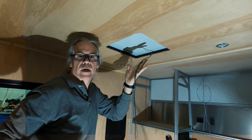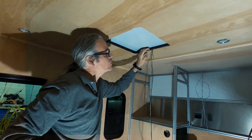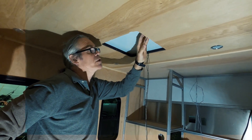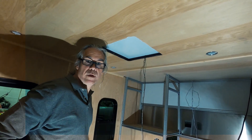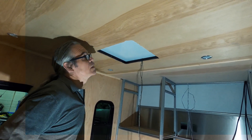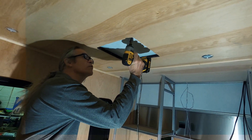At this point we're ready to install the fan — the Maxxfan — and that's what we're going to work on now. I have my two wires, positive and negative for the solar fan, and the roof has metal at 14-and-a-quarter inches all the way around. I'm going to punch a couple of holes through here with a step drill, and once I have the hole punched through I'll grab the reciprocating saw and very carefully cut this out — I might actually use a jigsaw, we'll see how it goes.